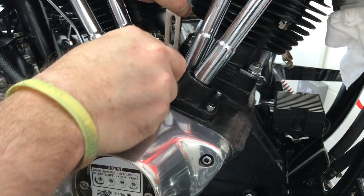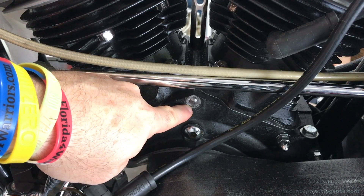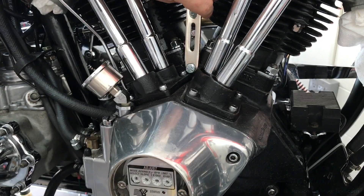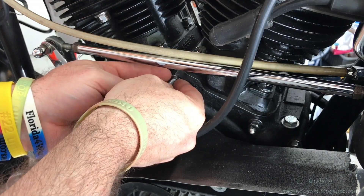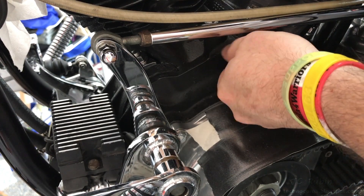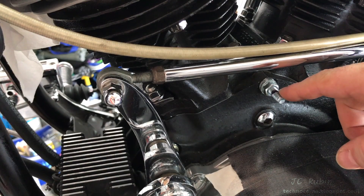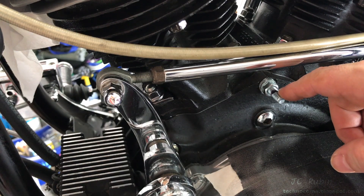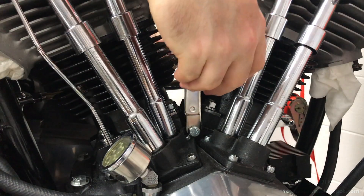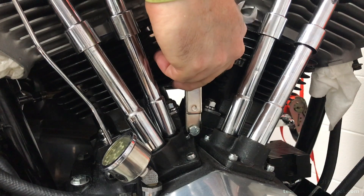Place the bracket in position and put the bolt back through. Immediately I realize there's a problem — the bolt is too short. I went to Ace Hardware again and they helped me out with a longer bolt. Using the longer bolt I repeat the process — now we have too much thread, but that's fine. I'm going to tighten down this nut and I'll actually benefit from this because I want to hold the clutch cable in the future. I'll mark it with enough threads to put on that bracket, remove it, cut it, and reinstall it. Taking the slack out — I have a wrench on the half-inch side to hold position and a ratchet on the other side. Just making sure it stays straight — not buckling it down just yet.